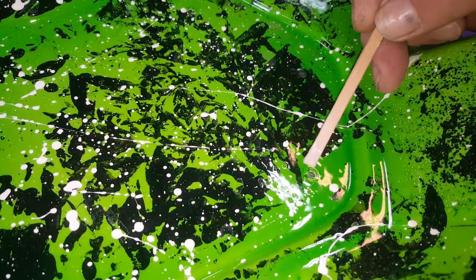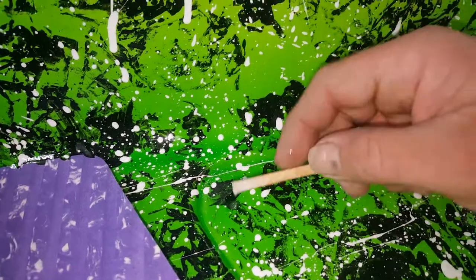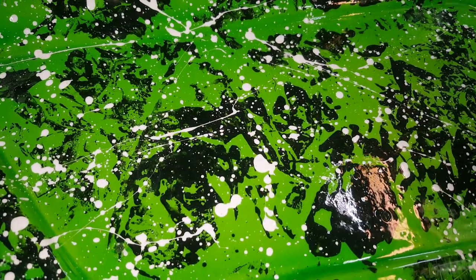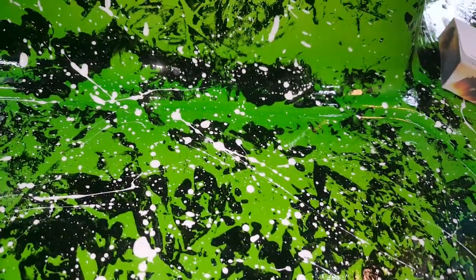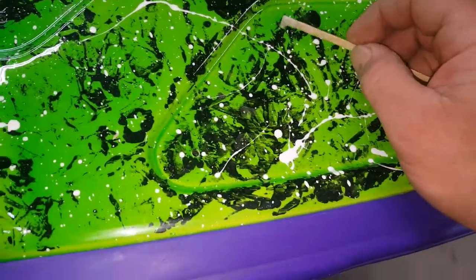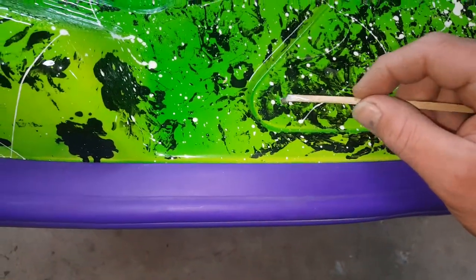What I'm going to do is wait for this to start getting a little sticky, and then I'll come over and scrape it off so I don't have to sand it. It's very important to get this flat — otherwise this pad will not stick. If it's not flat, the pad won't stick quite right because it will have a little lip inside. So I need to make sure I scrape it when it's still sticky. I've got to do the back as well.